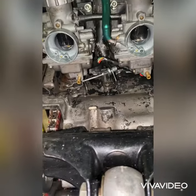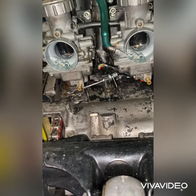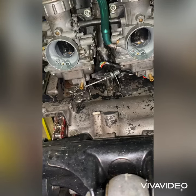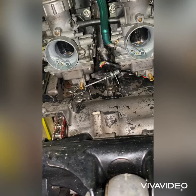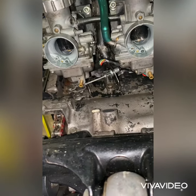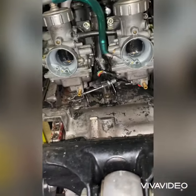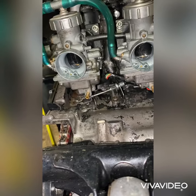With the carburetors, you want to make sure both of them are hitting exactly at the same time. You can see that right one hitting a little bit before the left one, so we got to even it out — we're going to fix that. Now we got both of the carburetors on point, both are moving exactly at the same time.